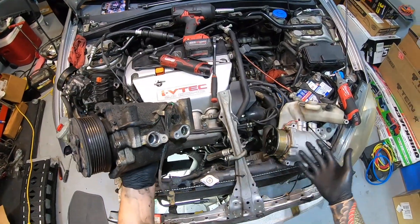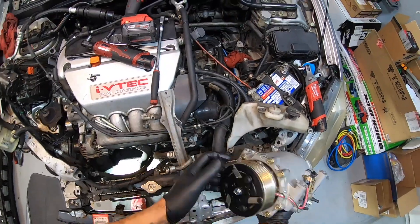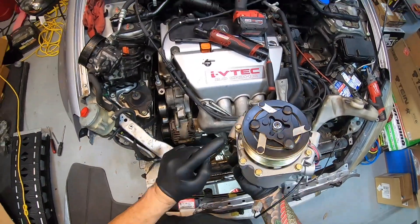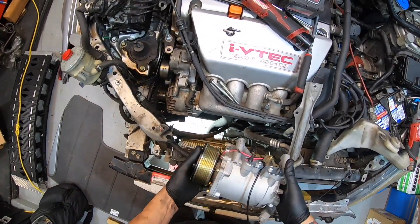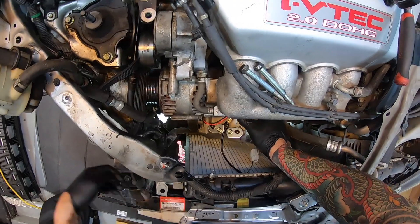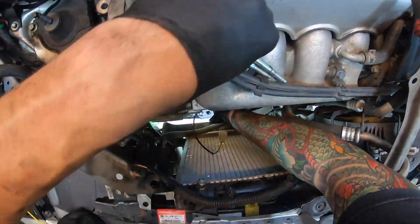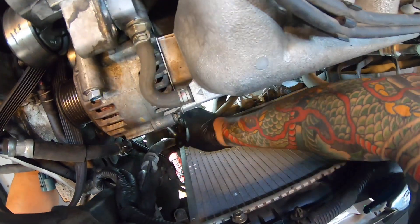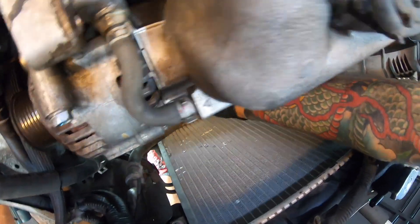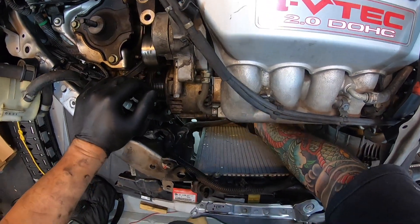There are the bolts. That one will come out; this one right here won't come out all the way until you loosen it all up. Then we can just pull this sucker right out — pull it right down through here. There we go, this is the old yucky one. Check it out — brand new one versus the old one. Slap this guy back in there. We're going to stick this bottom bolt in now because it's kind of difficult back there, the one that's closer to the pulley. Just try not to pop the radiator. Not having the bumper and stuff makes it a little easier. Get her kind of close, put the bolts in — just get all four in here nice and loose, get them started, and then tighten them all down. You want them loose so you can adjust the compressor around, especially if it's aftermarket because it's not going to be exactly the same as your factory one.